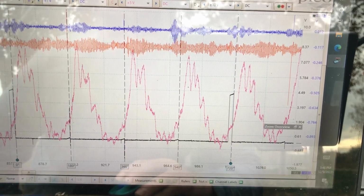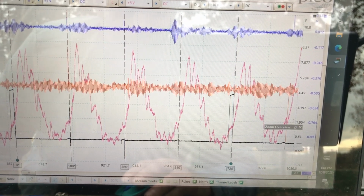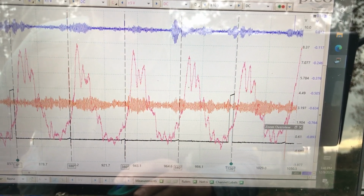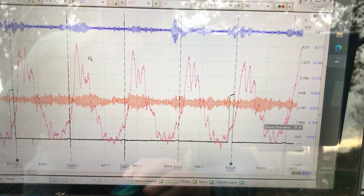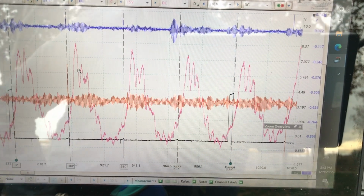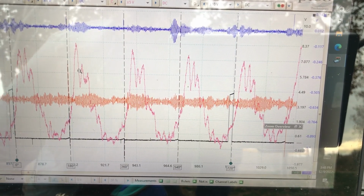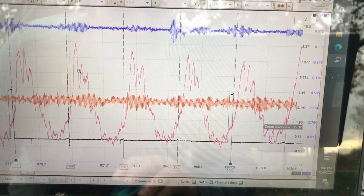So we know that when an exhaust valve opens, we have a cam lobe that's going to move a lifter or a push rod or pivot or rocker arm, push down on a valve. And the variables associated with that, we got to realize different specific technologies. Vehicles have VTEC, variable valve lift, active cylinder management comes into play. So we got to know what we're working on.